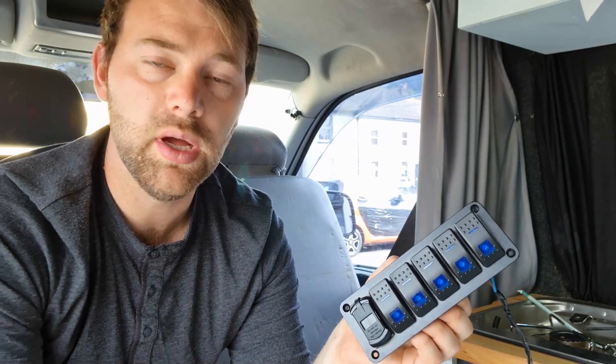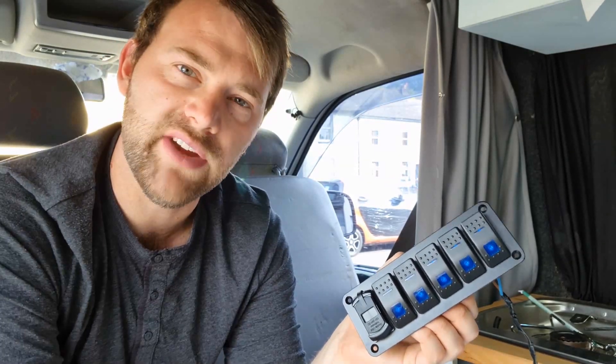All right, hi guys — it's pretty much all finished now. I've got all the wiring in, the relay in, and I've connected it all up. It wasn't too bad to fit in the end; the wiring is quite simple, it's just really fiddly where I've got this fitted in the van — it's underneath in one of the small covers behind the inverter and by the fuse board. It's a bit difficult to get in there. When I come to fit the relay for the inverter, I might do a slightly easier option and fit it under the seat next to the battery — it'll be easier to get to if I need to look at it in the future.